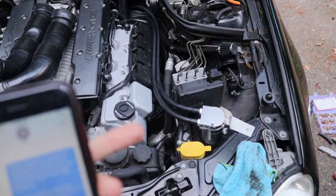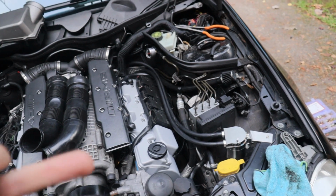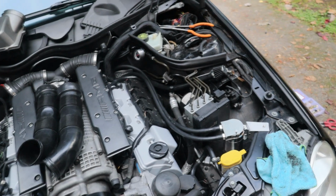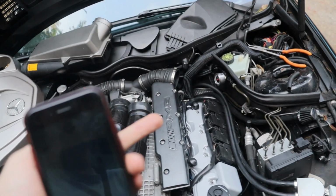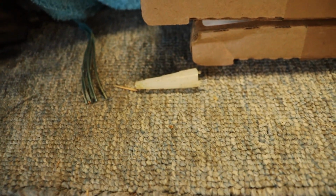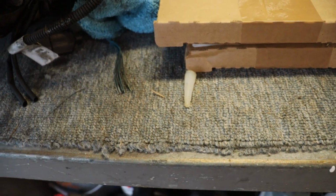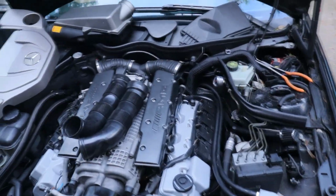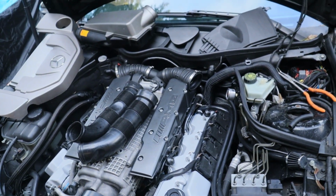Alright guys, so I got those lines for the catch can rerouted a little bit to make them a more horizontal approach, so it's not dipping down and getting stuck in any spots. Catch can was pretty dang dry, so I don't think it was pulling much. I pulled those 2 pieces out of the PCV. Basically I just used silicone funnels and cut little orifices in them. It worked, but I didn't feel good about leaving them in there long term, and now that I know the cold start issue is not because of that, I'm taking them out.